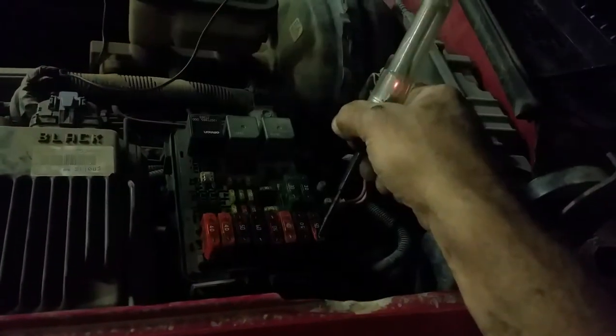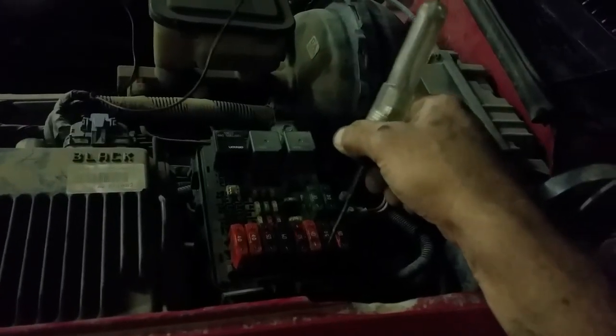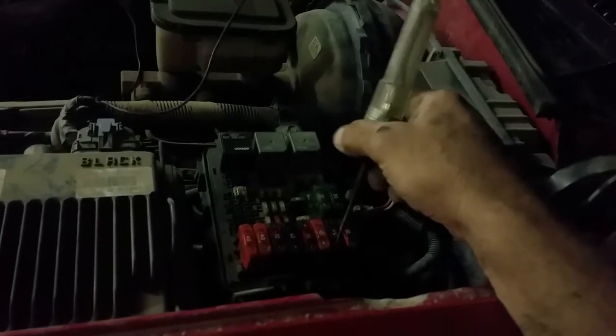So the next thing you want to do is check your fuses. And that is the problem with this one — I have absolutely nothing because I have a fuse blown. The ignition or battery fuse is the second fuse. You can see that's lit up, we'll check the other side — it's lit up, that's lit up, that is not lit up. So your battery fuse is blown.